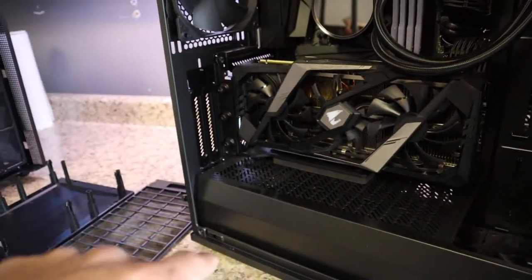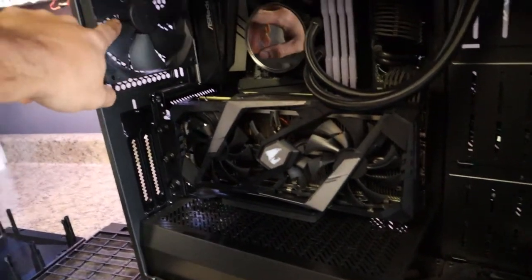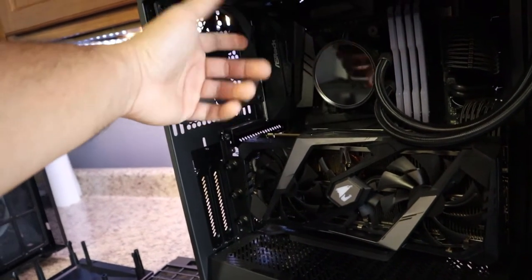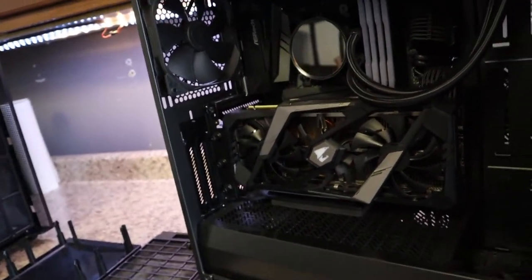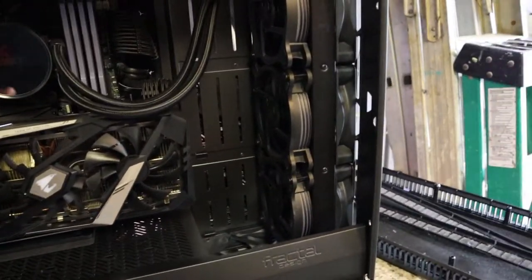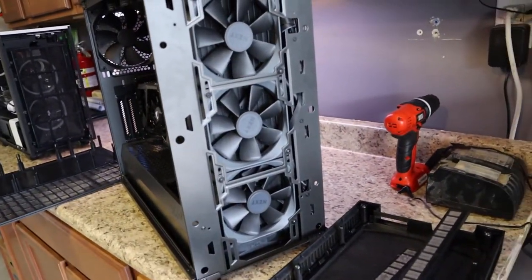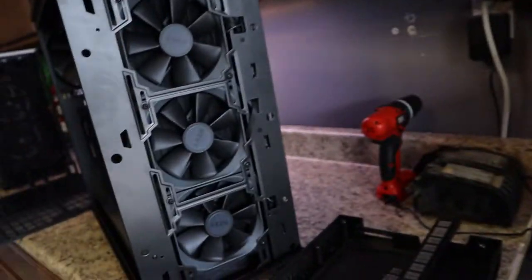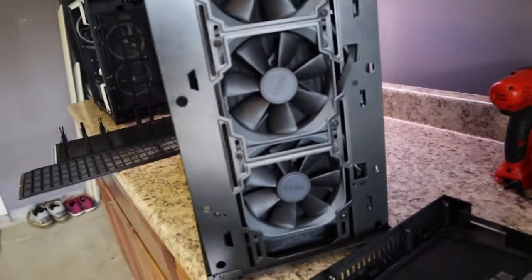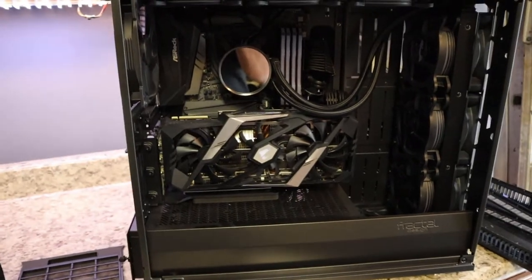Let's say you're working around the fans — when you go to do your cleaning process, blast it all out, but be careful that you're not injecting air directly into them. If you overspin these, you can literally do what's called spinning the bearing and it will pretty much completely destroy said fans. Another good idea: if you're not too trusting of how much pressure is coming out of your air regulator, you could take some painter's tape and roughly tape off every single one of your fans. That way they're not actually spinning as you're blowing all the dust out.